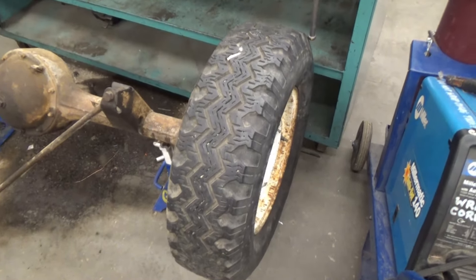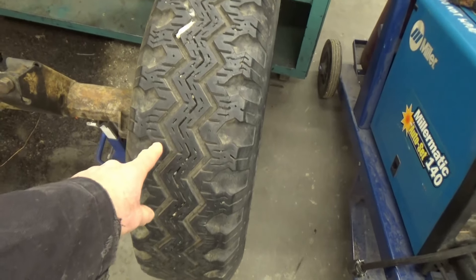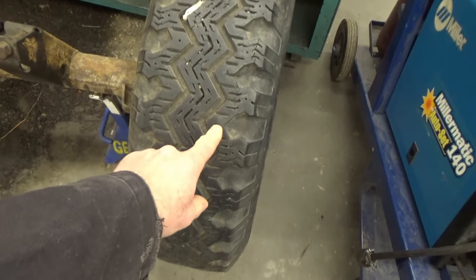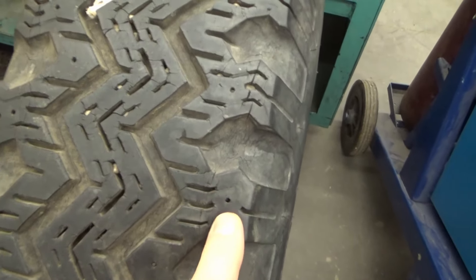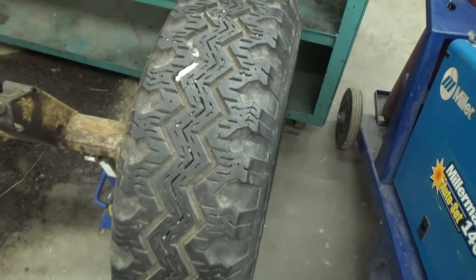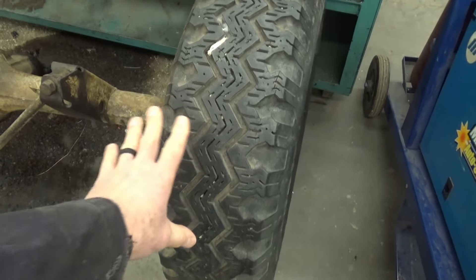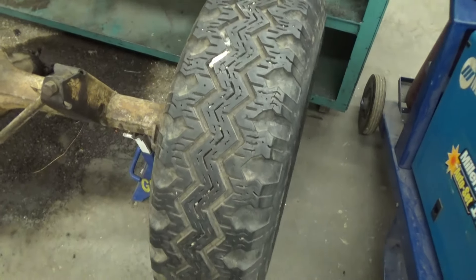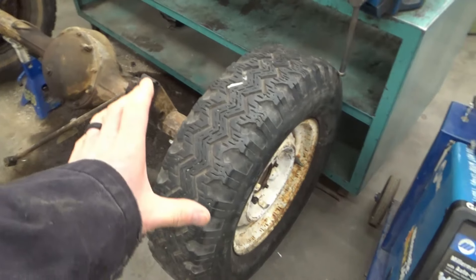We're in the school shop now. This is the way winter tires used to be made — the zigzaggy big lug style. This one happens to be drilled, so you could have put studs in these if they were new — they're studdable. Back in the day these were better than an all-season, but not frighteningly so. You won't see a winter tire with this particular style anymore unless you're doing a complete vintage restoration.